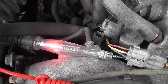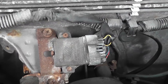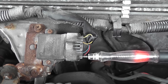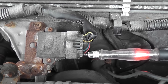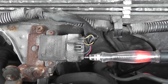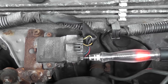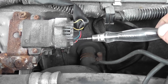At this point we want to focus up here at the igniter and do the same test on the blue and red wires. I've moved the test light up to the red control wire on the igniter — this is coil negative control. The light should be lit right now, telling us the coil winding is intact and there are no opens between the coil and the igniter — that's a good circuit. Crank it — again, no flicker, no control.